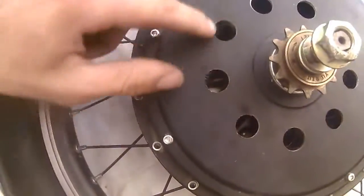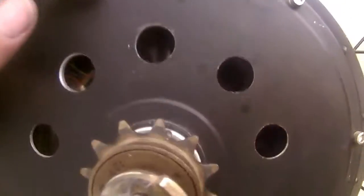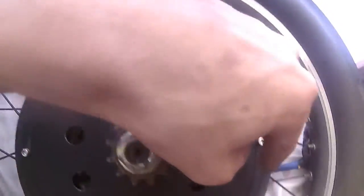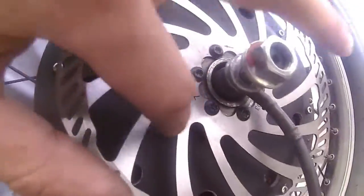Okay, now we got the wheel. Basically you see these holes — these are not big enough. I wanted to make them small but it wasn't a small idea. So we're gonna make those ones bigger and add some more holes around the edge of the cups. On the other side I'm gonna make those bigger and add small holes on the inside. So we have a few things left to do, which is take off the rotor, take off the freewheel and the nuts from the wheel. And then I can open the hub.